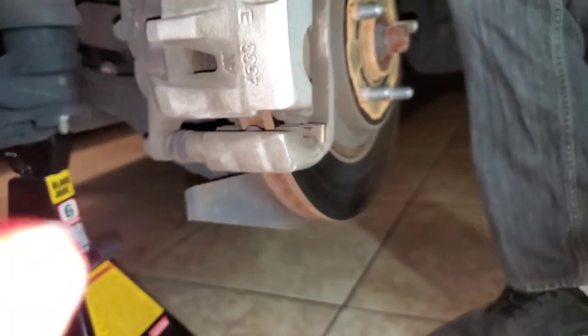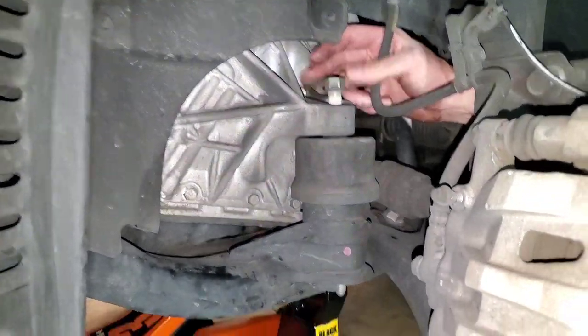There's this huge lip. It's right in there. And now we got some light coming. There it is. So there's those bolts right there, and they're pretty darn tough to get to. And they go all the way around, and once you get those off, you're good to go, and then we can change out the filter. So this frame is in the way, so what we're doing is he's going to loosen this bolt right here, and after that's loose, that's going to allow us to flex this whole thing up.